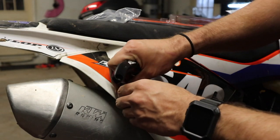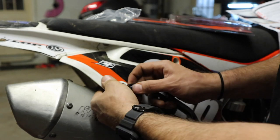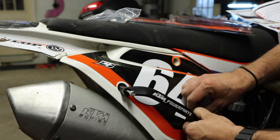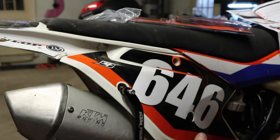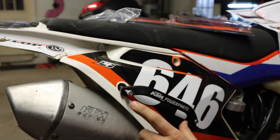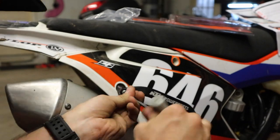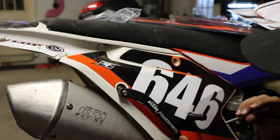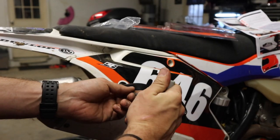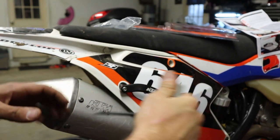The handle is going to fit on here like this. We just want to get that started so it bites. It's not biting all the way — I just saw the exhaust drop. You are going to need an Allen head in order to put these in; I'm guessing that's a five, so let me go grab one. If you want to torque these back to spec, it's 10 Newton-meters, or you can just hand tighten them — it's not that big a deal. It's installed.